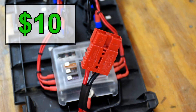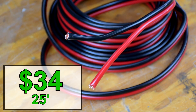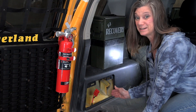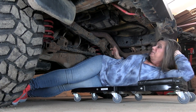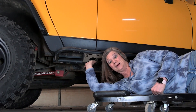On those wires we're using an Anderson plug to make the panel easy to remove. We ran both positive and negative from our battery using 8-gauge wires that are bonded together. Since the cables will be run underneath, exposed to mud, dirt, and road salt, we added some protection by running them through this common plastic conduit. Starting at the rear with the other half of that Anderson plug, then down through the rubber grommet in the floor, we crossed over to the other side and ran the cables along the frame, making sure the cables couldn't be pinched, cut, or melted on the exhaust.